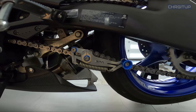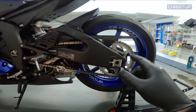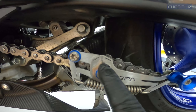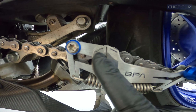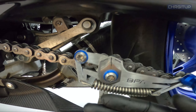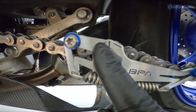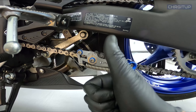That's how it looks when it is in the good position. Remember the chain is adjusted to where I want it to be at 40 millimeters, so that will always show me 40 millimeters for the adjustment. Now you're going to ask: how does this actually help me when it comes to adjustments? The tightening process is the exact same — loosen the axle nut, loosen the locking nuts, and move them side to side slowly to get to where you want your chain slack to be. The difference is the next time I check it, if the line is this way it's too loose and if it's that way it's too tight. That way you don't need to measure going up and down on the chain like I did in the previous video. As you're doing the tightening on each side in small increments, this little line is going to go from tight or loose and come back to perfectly align with the line in the back — and when it does align you're golden, you're at that specification.